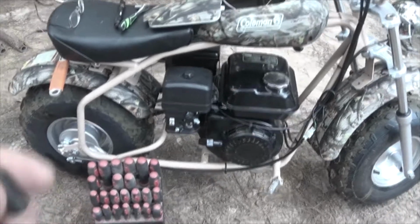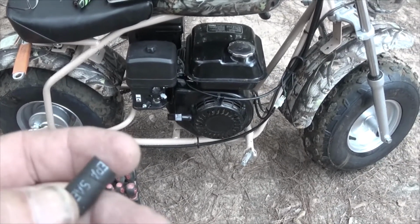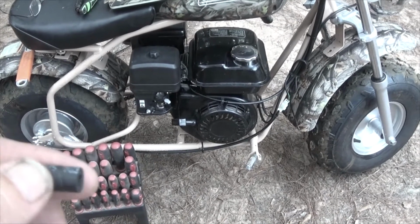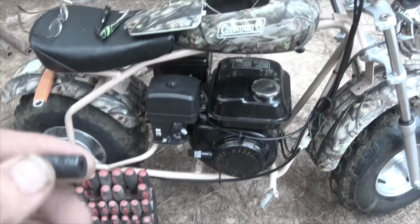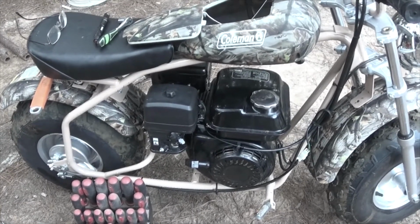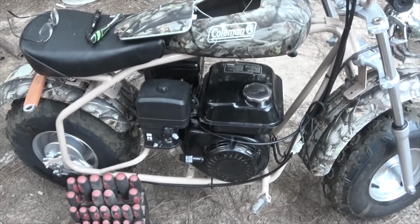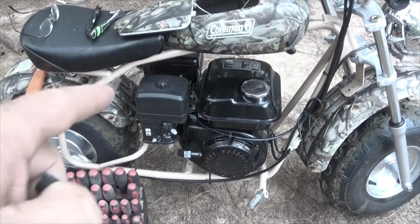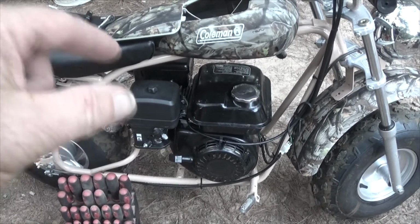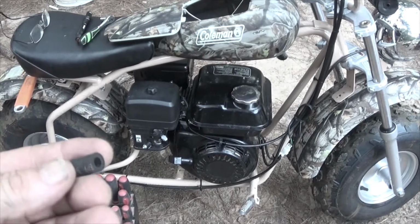Now I'm thinking that the thing was loose from the fuel tank where this ring was seated, because it was too far back. I'm not sure what that's showing, but it was just behind the copper line that comes off of this. Now once I took the tank completely off, physically removed it from the bike, I found that what connects there, you have a plastic tank, and then you have a nylon grommet that comes down, ties into a nipple that ties into this fuel line.